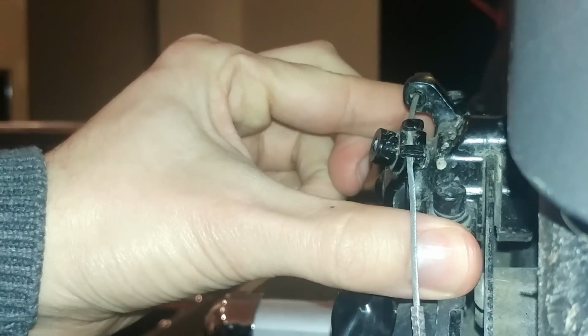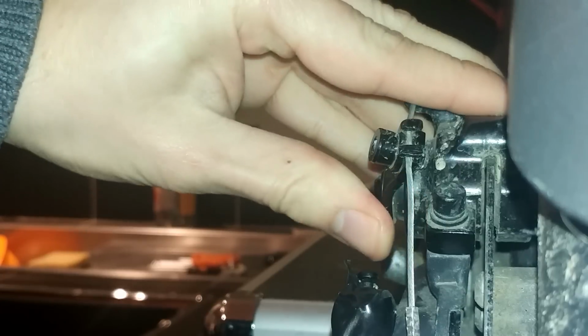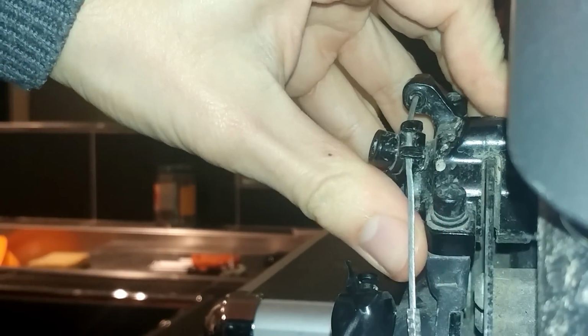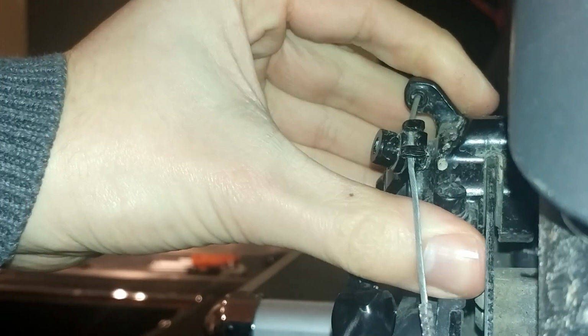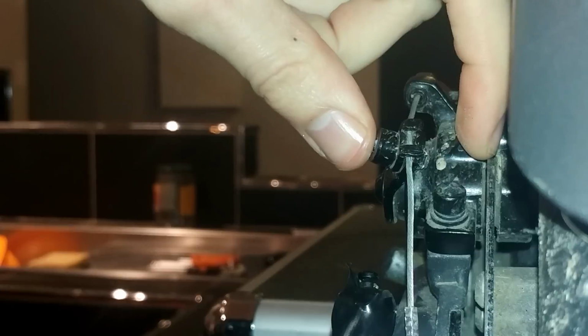Okay, step one is to align. Now I can move it like I want to. What you want to get is to have the disc and the caliper perfectly aligned. So you see, I can change the position, change the distance, but more important is the angle between the front and the rear. Here we can see some space, so it's not too bad.